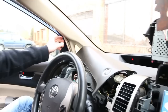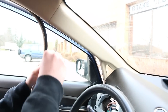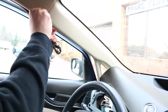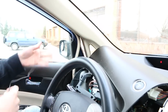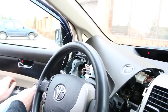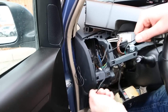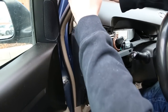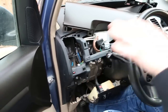We're going to open the door a little bit and pull this rubber down. I'm going to put the microphone here on top, and then we're going to feed the wire and work our way down. The point is to get the wire behind all this plastic and feed it behind the radio. It's hard to see but there's a hole here on the side — I just put the wire through over there at the back and now I'm pulling it through. Make sure you take your time. Now we have the wire here and we're going to continue from the inside.